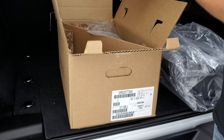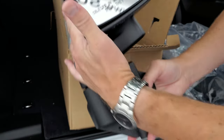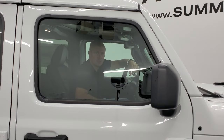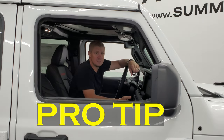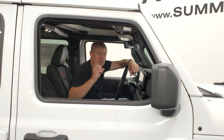This is how they come out — just in a bag, that's how they look. We'll show you how to put these on. For my first pro tip of the day, put all the windows down in the doors you're going to be taking off. Number one, it's easier to carry them with the windows down. Number two, while storing them, it's easier to avoid breaking the windows if they're safely inside the door.